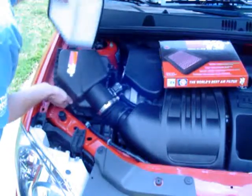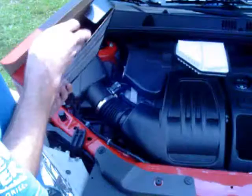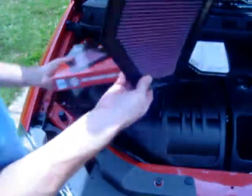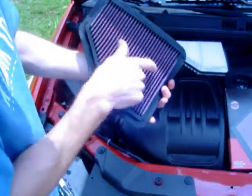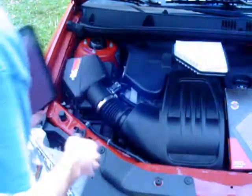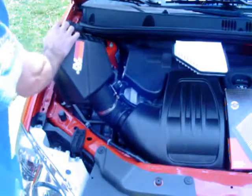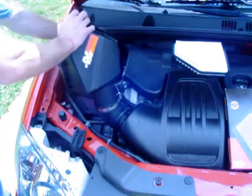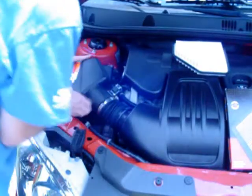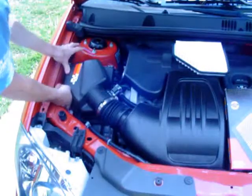You should be able to move this around just a little bit. You want to take out your stock air filter — that's what it looks like. You open up your K&N filter airbox; it should be in plastic wrapping but designed just like the stock one. It only drops in one way — the little filaments go downward because they're going to repel all the dirt. Take a look in your airbox, make sure there's no leaves and grime. You can use a vacuum cleaner to clean it out, then simply follow the pattern, drop it right in, line it back up with the clamps, and run your thumb clips back on there.